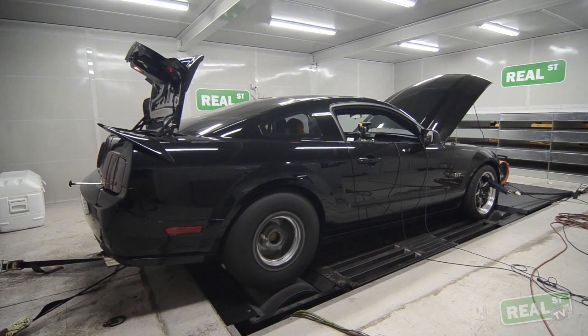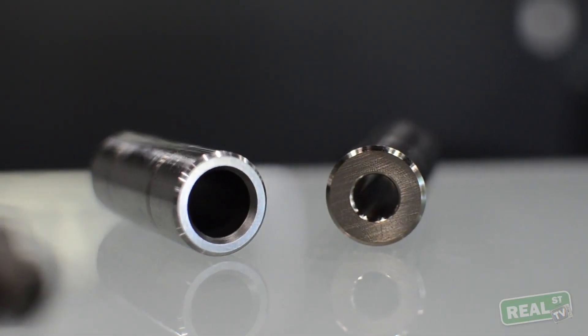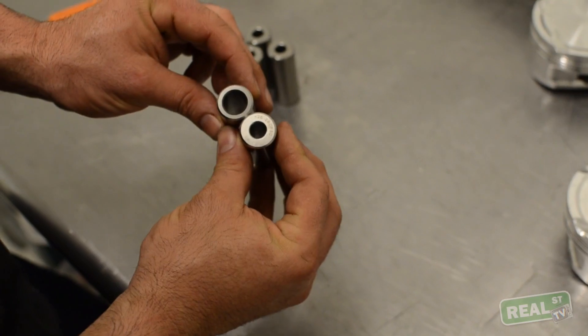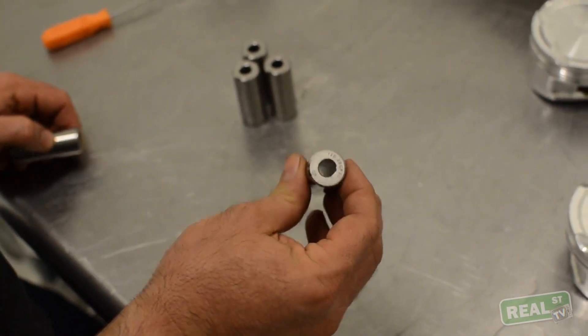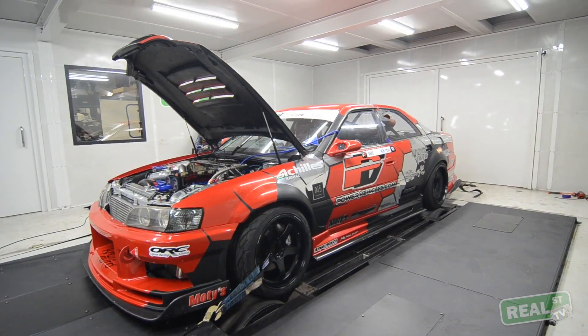The pins are very important. If you're using a turbocharger, nitrous, or supercharger and you're using the standard pin that came delivered with the piston, there's a good chance you're going to overwhelm that pin. The pin was only designed for so much stress, and the way they increase its durability is with an increased wall thickness or a material change, which allows the piston pin to deal with the stress and load of forced induction or nitrous better than a standard pin.